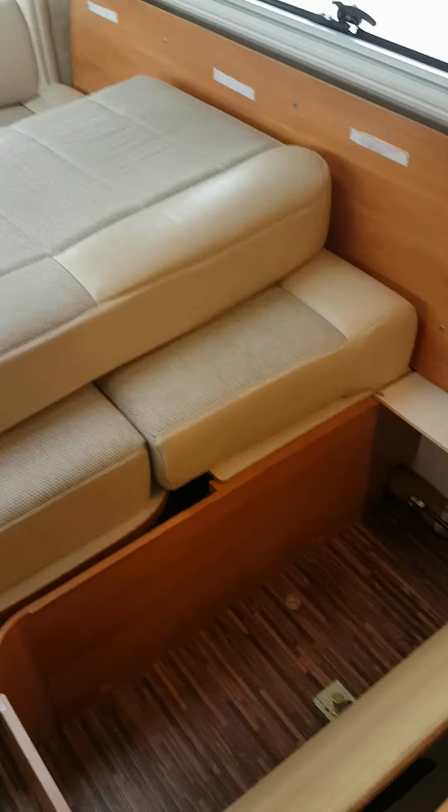So we're just moving around here to the sitting area here. I have this board lifted up, and in underneath there, if you just have a wee look, just beside the wheel arch, there's your main trips. So that's your 220 volt trips there. There's just one trip. So that's your mains trip in there. It's just beside the wheel arch underneath that seat.